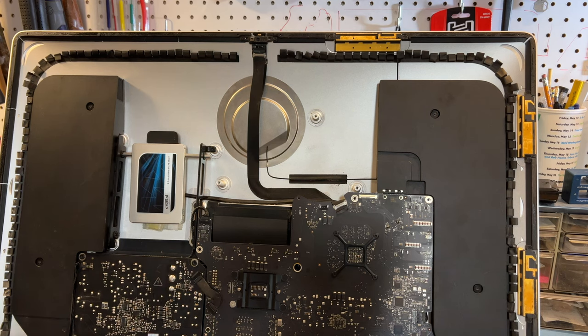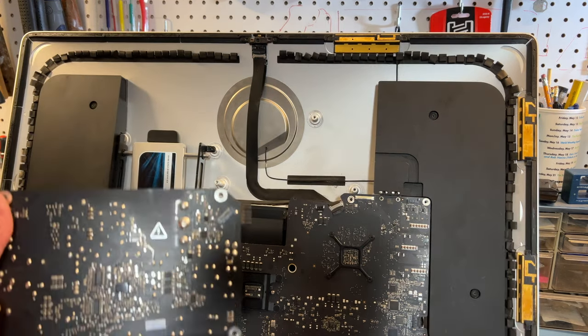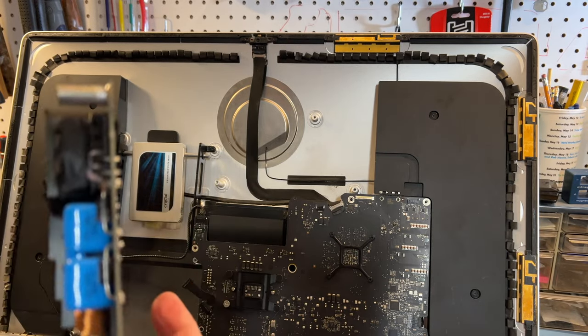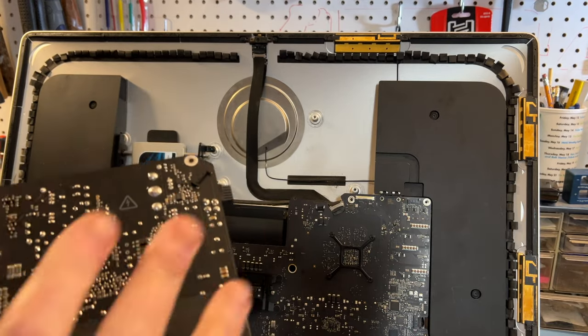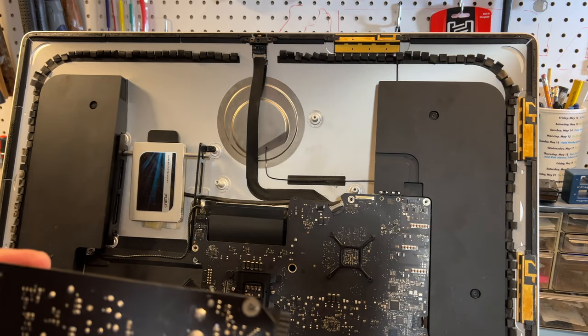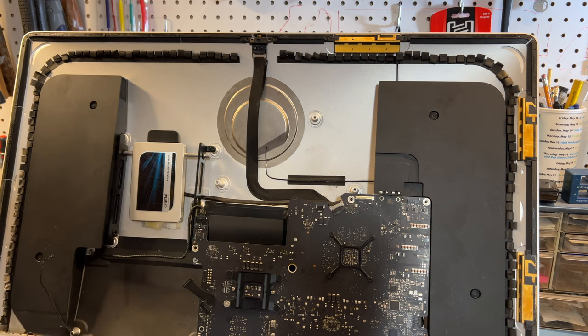I'm going to sit the screen out of the way so it does not get broken. This is the old power supply here, and there's the logic board. I've got the fan off of it. Even with this thing being off for several days, you want to be very careful — you don't want to touch that side of it, you could get zapped really bad. It smells funny. We did some voltage checks during the stream but got absolutely nothing, which is very disconcerting.